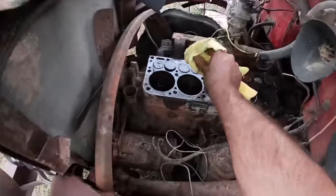I've spun it over a few times and now we know the engine will spin one complete revolution. All the valves open and close — everything does right. Even the rear piston came up. For a minute I was scared there might be a rod loose because it'd catch, but that is the transmission catching. I'm going to clean all these pistons off, clean everything up, shop vac it out again, fill it with more Marvel Mystery Oil, shop vac it, then probably fill it one more time. Then we'll put the head back on it and hopefully it'll start to build compression.